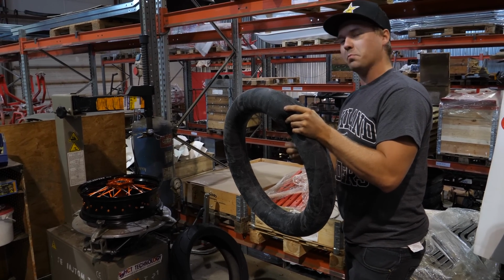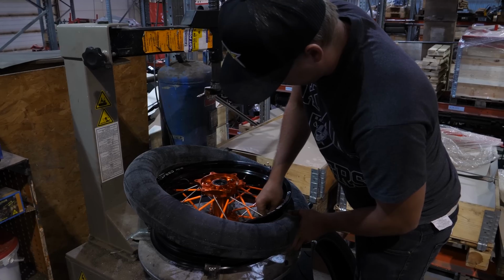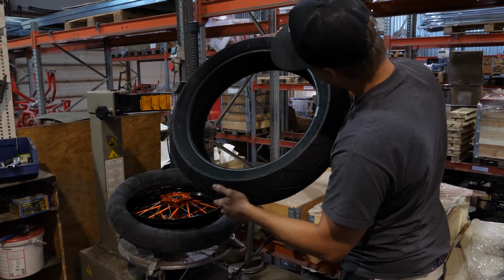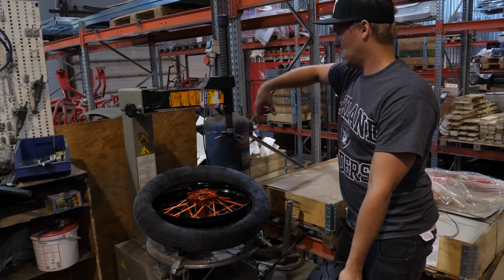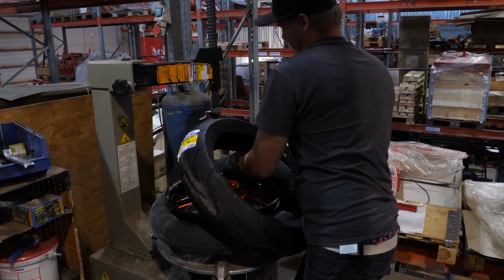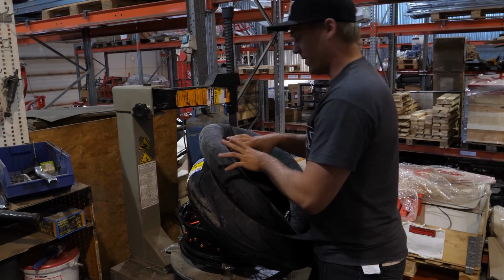Yep. And now let's place this tube on that rim. Like that. There is an arrow somewhere. There's not. Sometimes there is an arrow, sometimes there's not. Sprocket, so the wheel is rotating like this, so this arrow needs to point there, so now it's good. And we're gonna start like this. We pull the inner tube from here. And I fill the inner tube because it's much easier to handle when there is a little bit of air inside it.